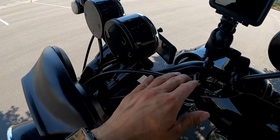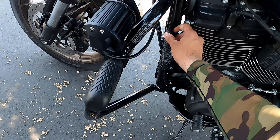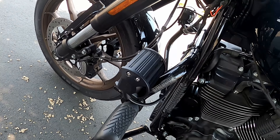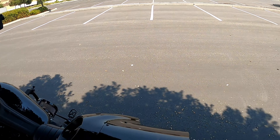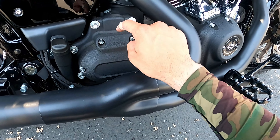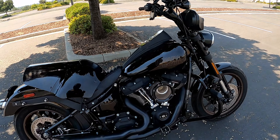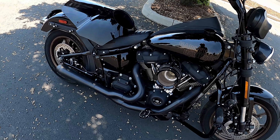The clutch line is the same — look how clean it looks, not too long. The one bad thing about this kit is the old-school clutch cable adjuster. You'd have to get into your clutch cover and change the whole cable. If you can get just the top piece of the clutch cable, you'll save yourself about an hour of feeding that cable all the way through into the clutch cover.